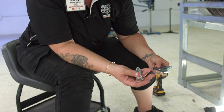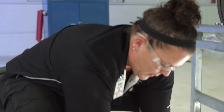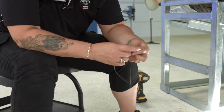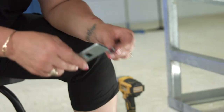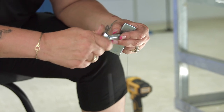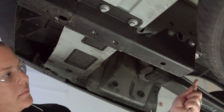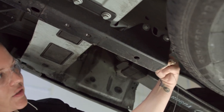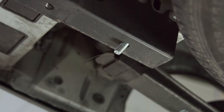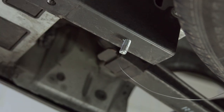What I'm going to do is install the two drop bolts — these are the carriage bolts with the spacers, washers, and nuts. Our hardware kit comes with two fish wires, one for each side. We're going to take the first one, put your spacer through, thread your carriage bolt, and feed it through the open access frame rail right into that hole. Pull it through and down. Leave your fish wire on so we can position the hitch without losing that bolt.